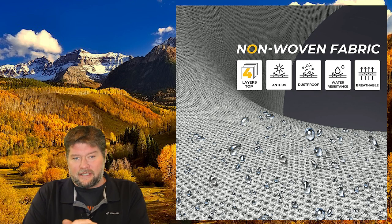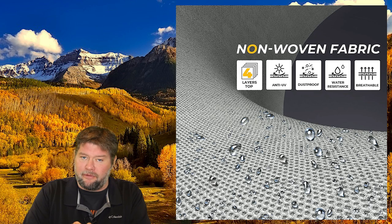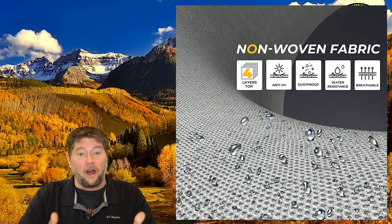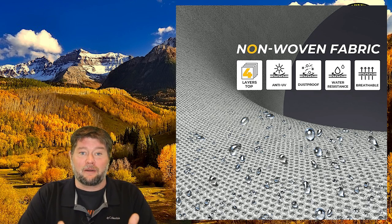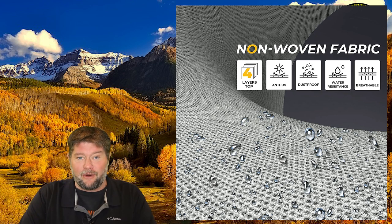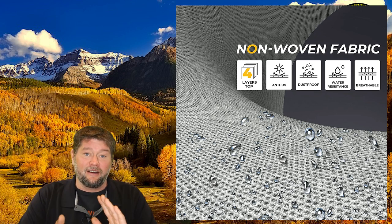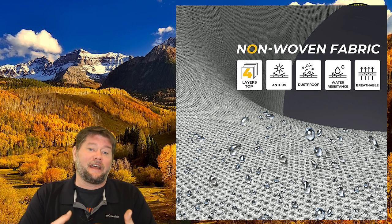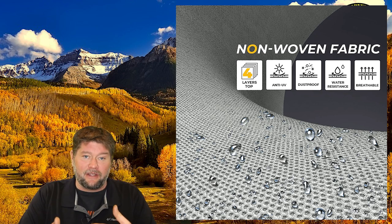Now, this is a water-resistant cover, and I was like, well, you want waterproof, right? The difference between waterproof and water-resistant is that waterproof — let's say you covered your RV in a big tarp, and it's completely waterproof, no water gets through it. That water goes down to the ground, puddles on the ground, and inevitably evaporates up underneath the tarp, and it will get things wet under there, and it'll stay wet. So it gets real humid and wet all over your RV, and that's going to promote the growth of mold and mildew and all kinds of stuff on the exterior of your RV.